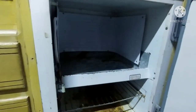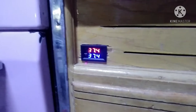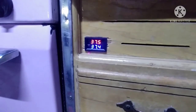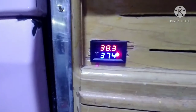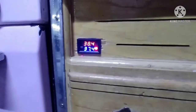In the case of this icebox, the evaporator is mounted with spacers holding it up, and our ice tray is still functional. Once it's all working, it stays at a nice 37 degrees. If you open the door you'll notice the temperature comes up a little bit — there's no mass in there right now, so we're just making sure it works. The temperature is coming up, which is good because it'll trip the switch to turn the compressor on.